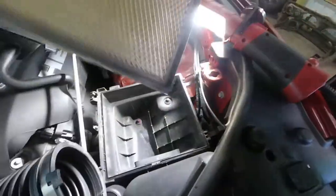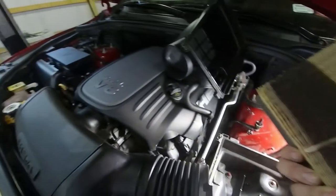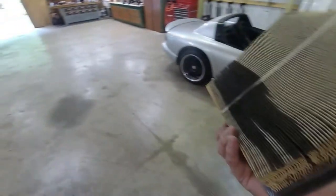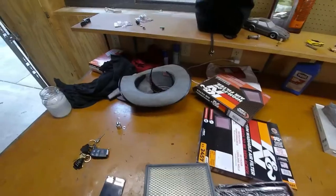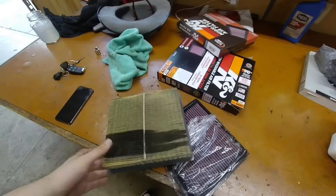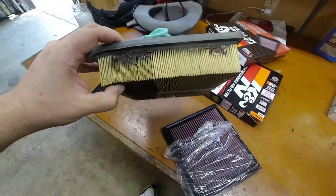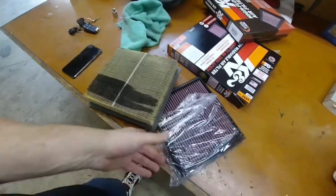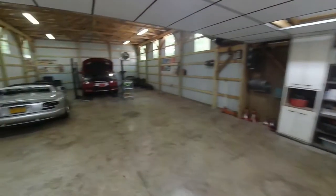This filter is pretty old — looks like it's overdue, for sure. There's a lot of oil in there too, which is surprising. It is the same size as the new one. Looking over at the air box, it looks like some oil got in from the air intake and just got sucked in. It is right next to the air intake from under the hood.